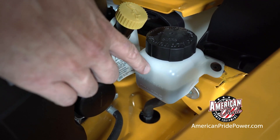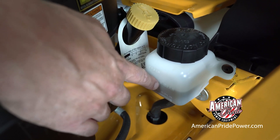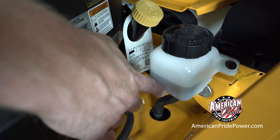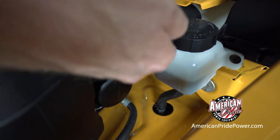Those units will have reservoirs which you'll want to check consistently to make sure there is fluid in them. The ideal level is about halfway between the bottom full-cold line and the writing in the middle — any more than that and when the fluid gets hot it will come up out the top.